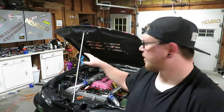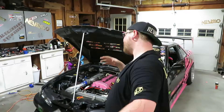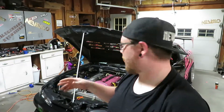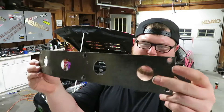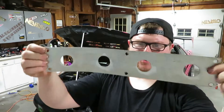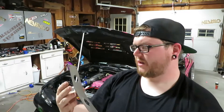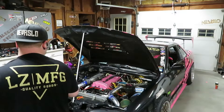Now I love my Pinko style coil pack cover, but it just doesn't have enough holes to make me comfortable. The coil packs and these SR's get actually really hot and they can actually burn themselves out. So this is actually one that I made — I drilled a hole over each coil pack.